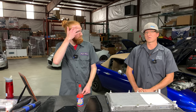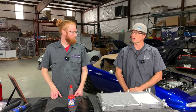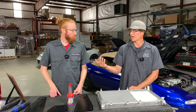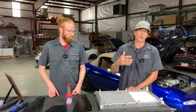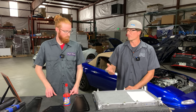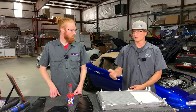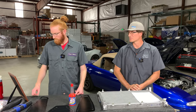Looking at our 1.6 instructions, we include a breaker coming right off the alternator terminal for a good power source, because the 1.6 is pretty bad at supplying good power to fans due to the age of the car and the wire gauge. You can use the same theory with other generations — bring power off a good known source and run a relay to trigger the other fan.